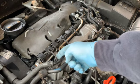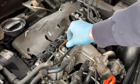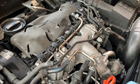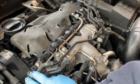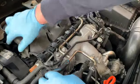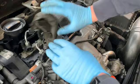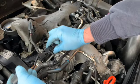What we're going to be looking at is these are the glow plugs here - they're just like what you'd probably consider old spark plug holders. The first thing we're going to have to do is remove a couple of harnesses just to make our life a little bit easier. On the common rail here we just have to remove that pressure sensor and then our number one injector connector, just remove that one, and that'll allow us to lift this harness a little bit easier.